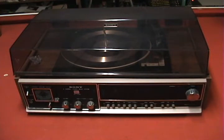There were two standards that were adopted for vinyl, which was the CD4, also known as the Quadradisc standard. This behaved like a stereo record with a carrier signal. So you had the stereo tracks, and then the carrier signal was taken in by the demodulator, and that split it up into four different tracks. The left back and left forward came out of the left track, and the right back and right forward came out of the right track. So you broke the two tracks into four tracks. To use this, you needed a CD4 cartridge, a CD4 demodulator, and a four-channel amplifier. So you had to have all of this.